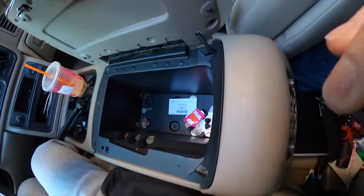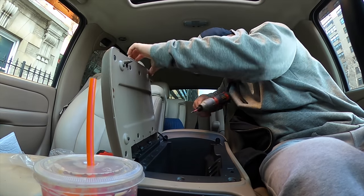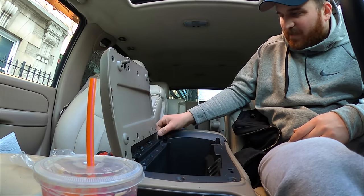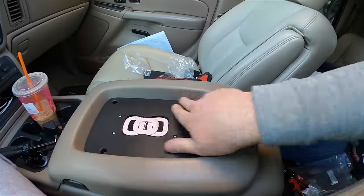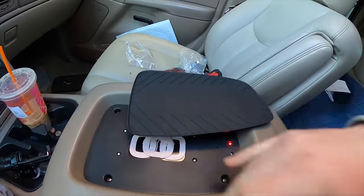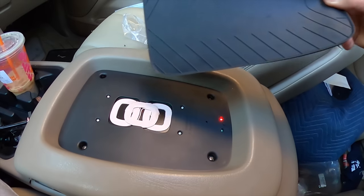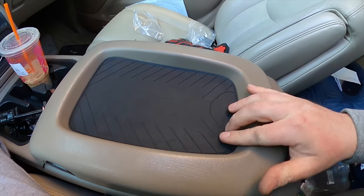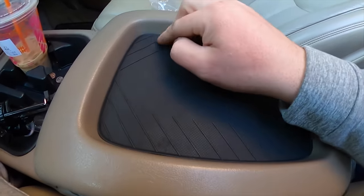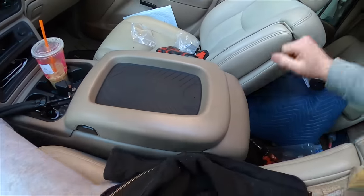Now this comes over this way and we can plug it into the pad itself. We've got illumination! Now we reinstall all the screws for the bottom of the lid. Make sure we have enough slack here. The last touch — this just has these little rubber legs that wedge into the screw holes. So you can easily pull this out to clean it, just like the factory thing. Oh man, look at that — looks totally OEM!